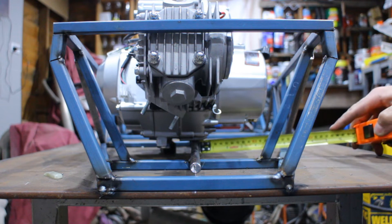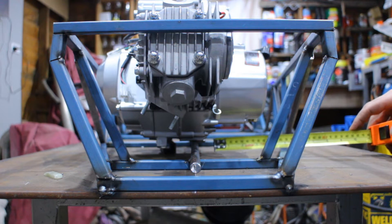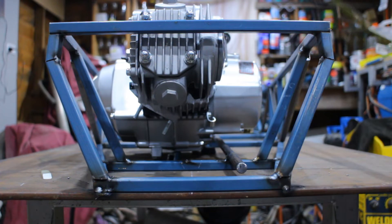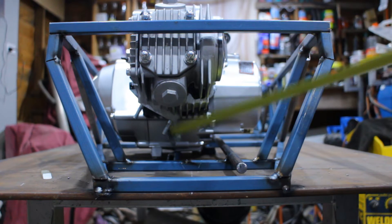Moving the steering shaft across this way at least 50 millimeters will let the whole motor sit down 30mm more. The only thing that would cause an issue is the steering setup where the tie rod ends will be unequal, but at this sort of size that probably won't matter — you won't notice a difference. I've got the motor in the position I want it; there's about two millimeters clearance under that drain plug, which is exactly what I want — the engine sitting as low as possible.